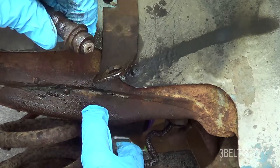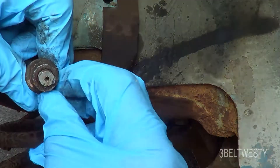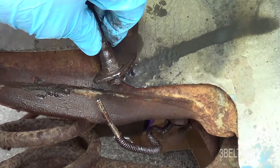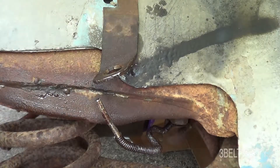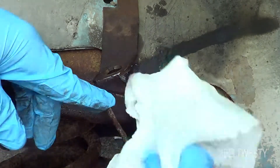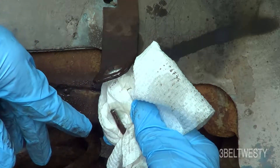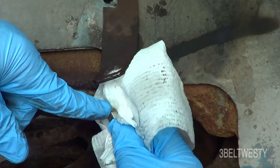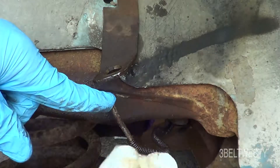I've been fooling around with this thing for way too much time. I've got a new line coming in from a place in Ohio — this goes in here like this. This has just been a nightmare. The other one I got off but it was really tough. This whole line is clogged up — some dregs came out and now it's coming out fairly clear, just by gravity. I want to see if we can clean it up, put a double flare fitting on it — it'll reach up there. I've got new stainless lines to put in here later.